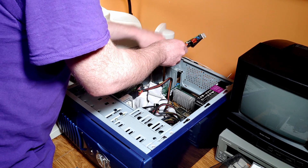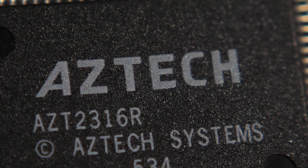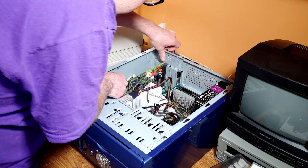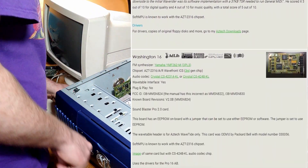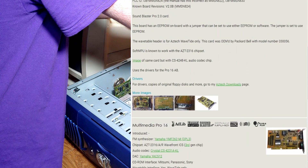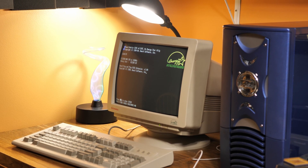Just so you guys know, I went into this install completely blind without knowing what to expect. This card uses the Aztec 2316R chipset, and this chip seems to have been used on a lot of Aztec cards from this time period, including the Sound Washington 16, the Multimedia Pro 16, and the Wave Rider. From what I can tell, these chips were used an awful lot in Packard Bell systems from the early to mid 90s, so this card is likely an OEM Packard Bell model.